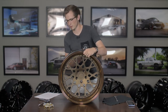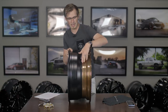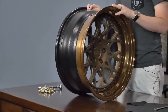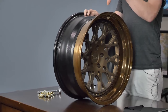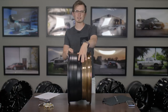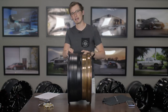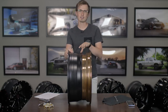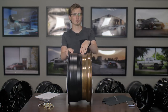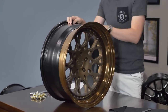Because we're doing things the easy way today, you may notice that these do not have any silicone seal. We don't have to deal with that today. However, if you're watching this video to learn how to disassemble your multi-piece wheels, most of the time you're going to have a silicone seal right here that keeps the wheel airtight. Three-piece wheels have it — it's either silicone seal, which is about 90% of multi-piece wheels, or some are actually welded. A lot of older Work wheels and SSR do it that way, but most new wheels are going to be silicone sealed.